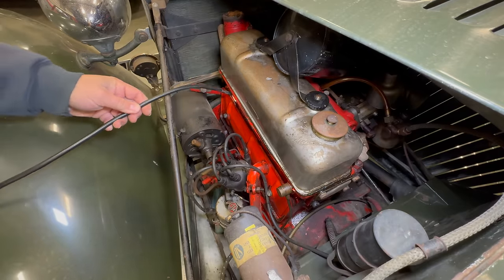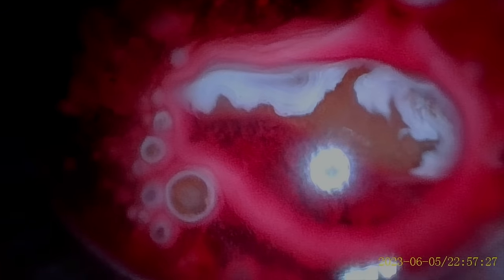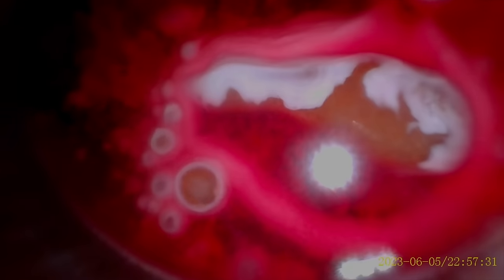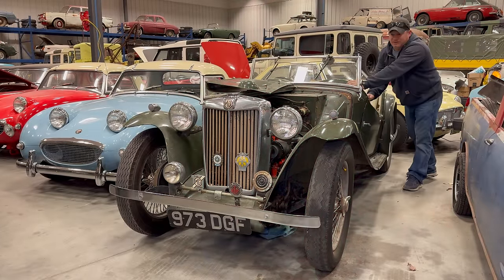Let's take a look inside. Here's cylinder number one — looks pretty clean. Cylinder number two — the ATF really cleaned up these cylinders from all that stuff that was hanging on there from the vinegar. It looks to be about the same amount of oil left in both cylinders. Number three — these spots must be from different chemicals put in there, maybe from the liquid wrench that I had sprayed in there. And number four.